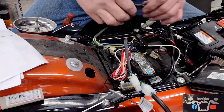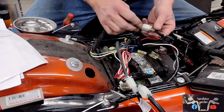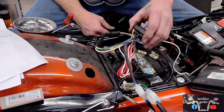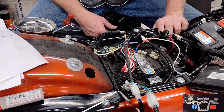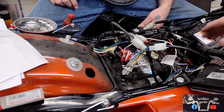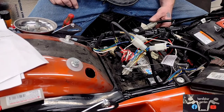You put this fuse in and the red wire goes to the hot side of your battery. Then the ground wire here is for the CAN bus. The other part of our isolator is going from down to the pigtail where the trailer is going to plug in. It looks pretty simple. After a few minutes we got it figured out. Just take your time and you'll get it. We just got to finish buttoning it up now, which is in reverse order of how we took it apart.